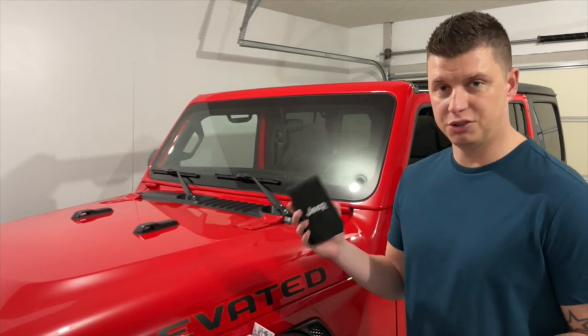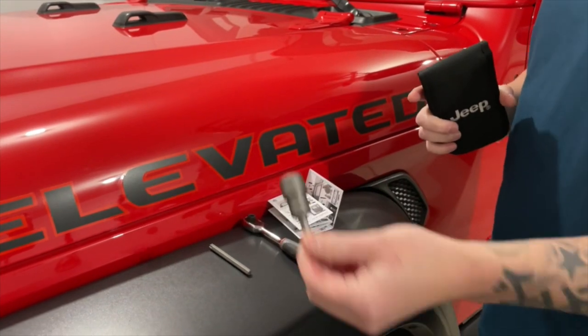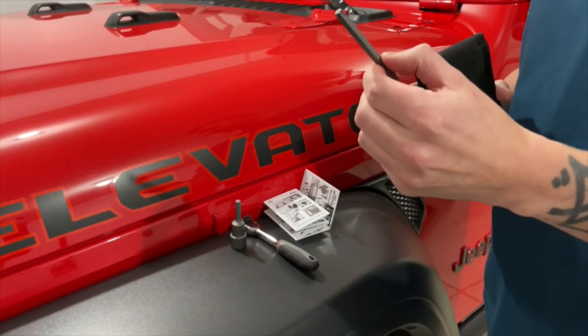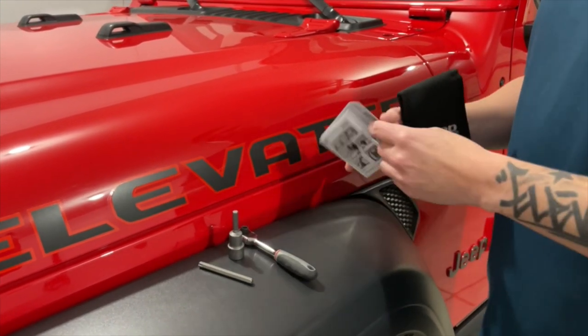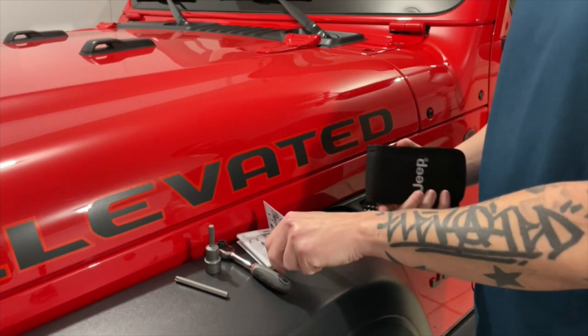The tools that you'll need today are going to come right in your Jeep pouch — that should be in your Jeep Wrangler. You'll need the ratchet out of there, the 15 millimeter socket, and the Torx 40-bit. Jeep does provide instructions on how to fold the windshield, so they're there too, inside the little pouch.